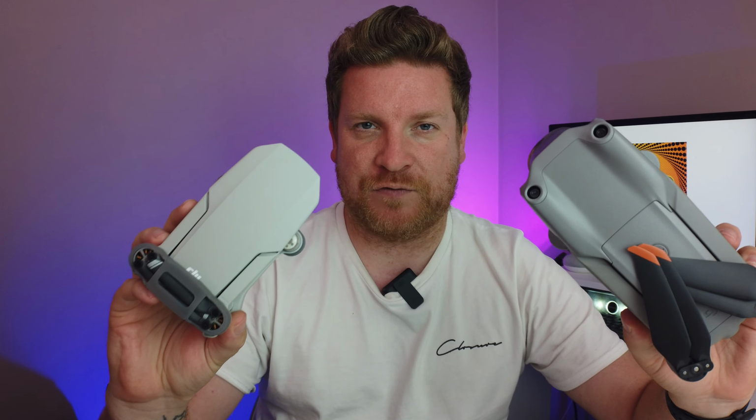For the purpose of this video, I will be using two drones. I'm going to be using the DJI Air 2S, which of course is OcuSync, and the DJI Mavic Mini, which of course is standard Wi-Fi. The reason for using two different drones is that it takes out the differences in terms of model specifics, and one model might be a little bit more susceptible to interference than the other. So I'm going to try it on both. Not to mention OcuSync is slightly better at deflecting interference, so it makes sense to have the Mavic Mini with us as well.